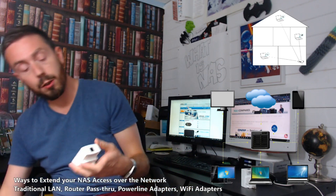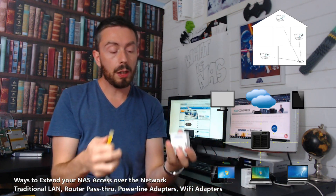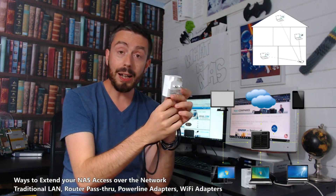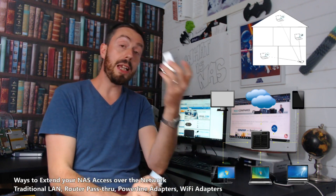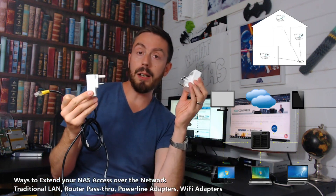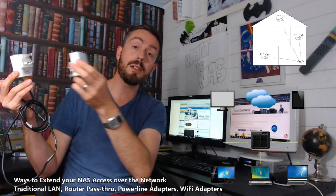Put simply: one end of a LAN cable will go into your NAS. The other end, rather than going into a switch or a router, goes into the power line adapter. I've got a UK one here — of course if you are in different countries, different regional plugs are available — and you plug that into your mains socket. Then at the other end, near where the router or switch is, you find the nearest plug point, plug in the other power line adapter, and run another cable from that adapter into the switch. With one plug connected to the NAS and the other connected to the router or switch, it uses the mains wiring in your home to transmit the network signal.